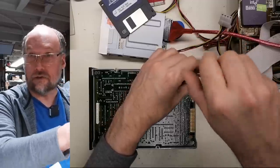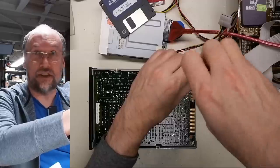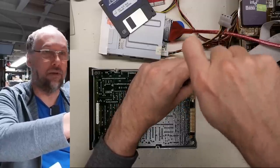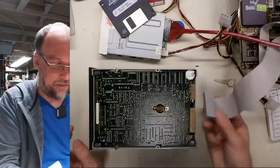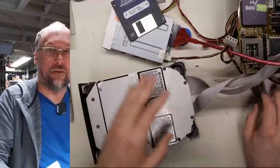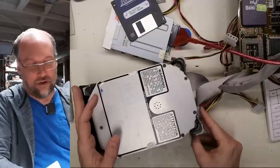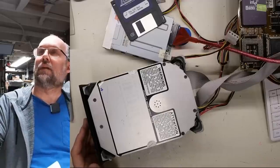If it is trying to read it, like it's accessing things and making it do stuff like that other Seagate drive, and then still not working, that would imply that there's a mechanical problem on the drive. But this drive, it would spin up and there wasn't even any signs of life. Like I saw no flashing, no nothing, which just kind of screamed that there might've been a problem, well, either with the electronics or there was an issue with the jumpers on the drive. We're ready to go. Let's turn this back on and switch the input so you can see what the computer is doing.